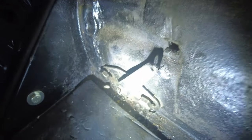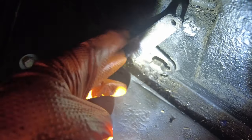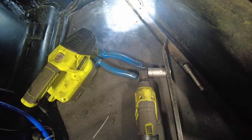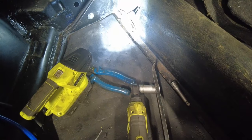The accelerator cable goes through that hole there. Now if you're doing the clutch cable it's a whole other kettle of fish — you actually need to take this oval plate off and get the accelerator pedal arm off. The other thing worth noting is that box may seem surplus to requirements to some people, however without it theoretically your passenger would be able to accelerate the car, and that might not be the best thing depending on who your passenger happens to be. It goes without saying that if you don't have a ramp you're on your back under the car, so make sure that if you are getting under the car you use suitable axle stands.